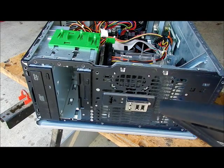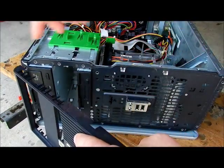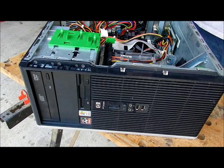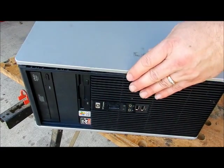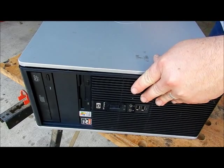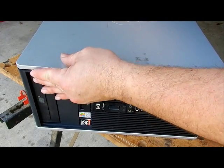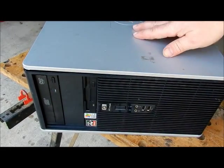When you're done putting the hard drive back in or upgrading, go ahead and put your two clips — they go in up here and then click into place. Then put the cover on — remember the little screw goes in the back. You have to go over this ledge here, slide it forward, and fasten it in the back. Make sure it's all the way on — it does take some playing around sometimes, but once it's on you're ready to reload your system.